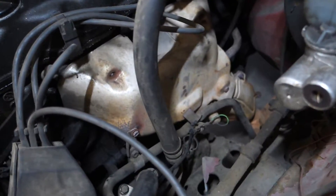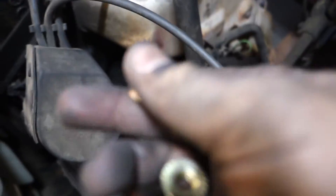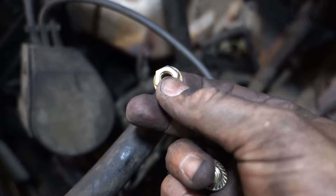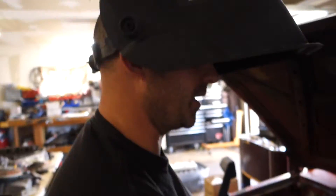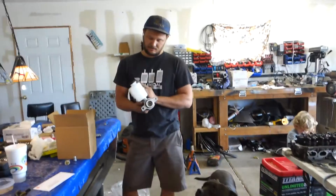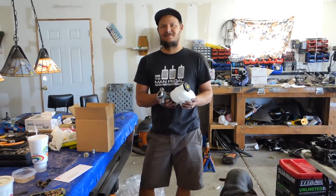I needed to get to this EGR tube back here and this heat shield is covering it. I managed to get a couple of the bolts out, but one broke off right there, the other one came out, and the other two are rounded off. So what we're going to do is weld nuts onto those bolts and see if we can back them out that way. Ronnie got some more car parts in and I'm over here slaving away with this stupid heat shield while Ronnie's getting car parts.